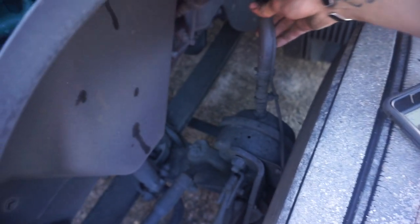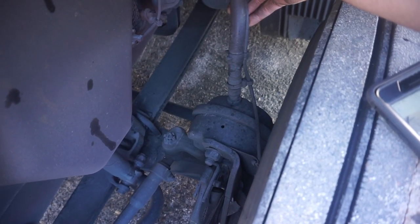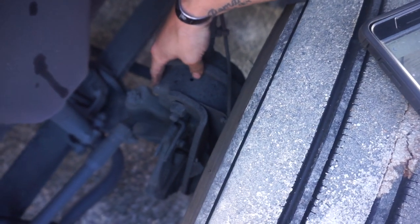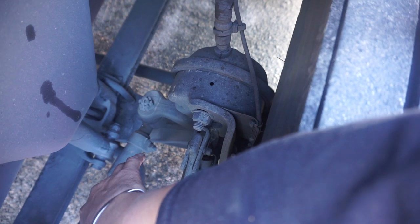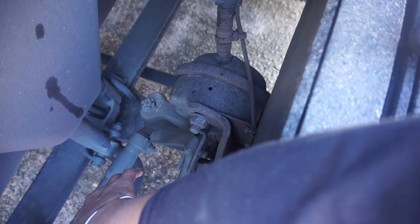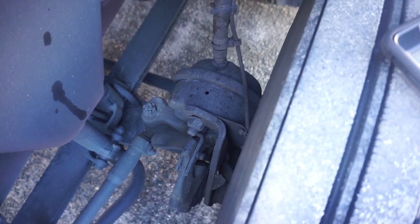Now go into the brakes. The brake hose is securely connected at both ends, not cracked or worn, and not leaking. Touch the brake chamber — it's not dented or cracked, securely mounted, and not leaking. Point to the slack adjusters and push the rod — they're securely mounted with no broken, loose, or missing parts. If the brakes were released, the push rod will move no more than one inch when pulled by hand. If brakes were set, we would look to see if the push rod and slack adjuster are at a 90-degree angle.